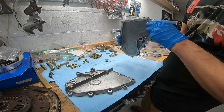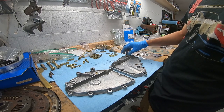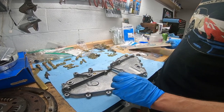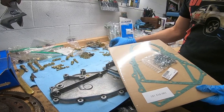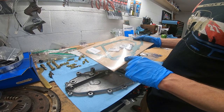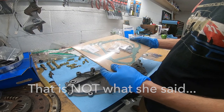Both of these look pretty clean. I'm not sure if there's supposed to be an o-ring on the back of this one, but I can always change that later. What I want to do now is install these timing chain covers. I have a new gasket set, but for aesthetic reasons I'm going to reuse the old hardware that I had replated as opposed to the silver stuff. The book says to install the gaskets dry, but I don't trust that, so I'm going to spray them with copper sealer.